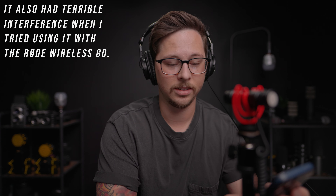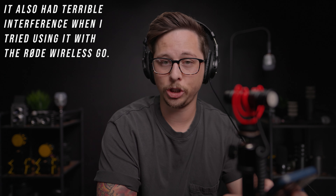For my last con, it might actually be the most serious one. With this microphone and this cable, I've already had some pretty bad experiences with RFI and EMI — electromagnetic interference and radio frequency interference. For instance, if you've ever had a microphone plugged in and you were sending a text message and suddenly heard a staticky sound into the microphone, you have some interference happening. If I put my phone next to this, you can hear some crackling for sure. But if this mic is meant to be plugged into a phone, which causes it interference, how is it ever going to not have interference unless you're in airplane mode? And having that interference combined with a permanently attached cable — that's rough.